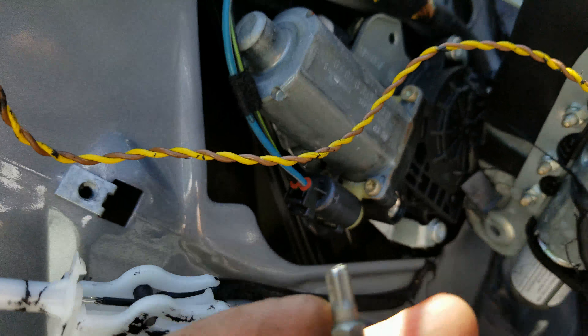Taking this out, you've got to disconnect it here. This is what I was talking about — if you let your window regulator operate while it's broken, the gear will wrap around the cable and get damaged. You can see the regulator is secured by several bolts. We're going to see what's going on with it, take it out, and try to repair it. You can see how it connects to the window — there are brackets.